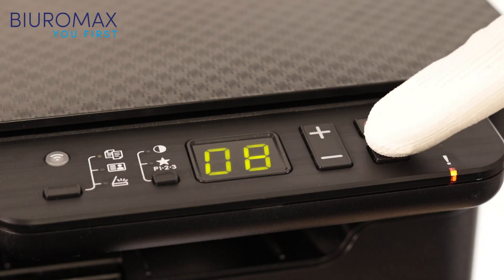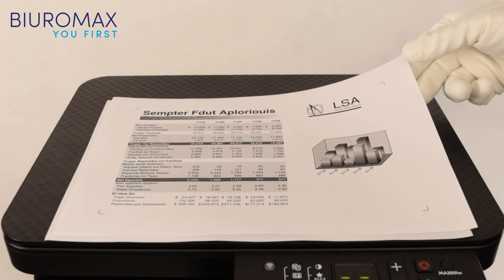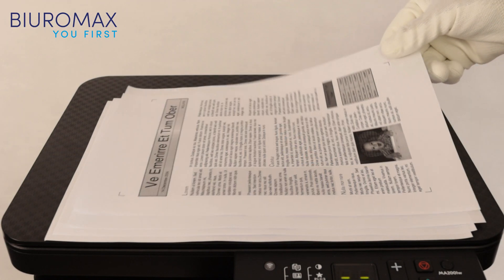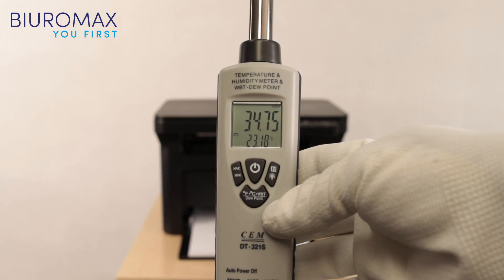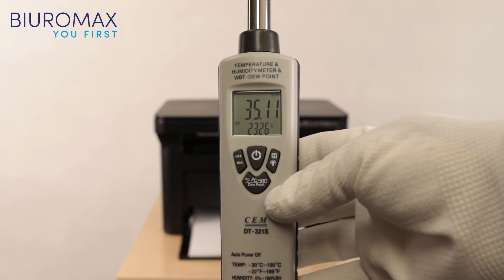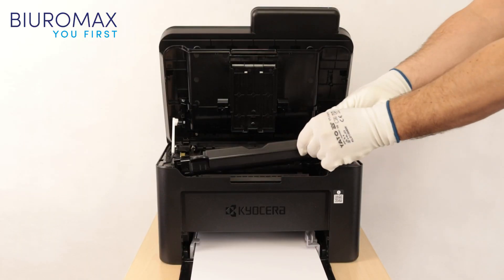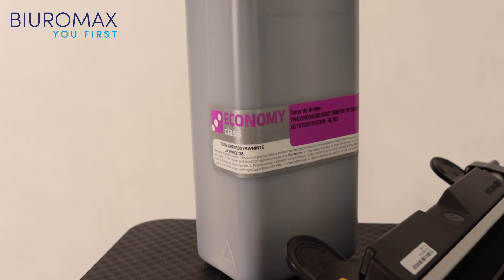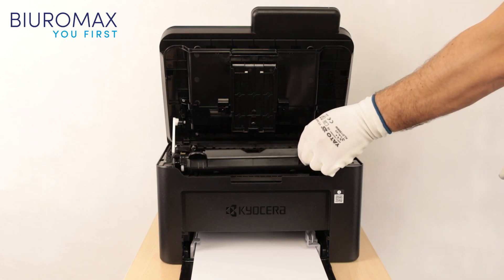The first copies and prints made with the original toner will be used for comparison after the test. Test sheets with five percent toner coverage were used in the test room. The temperature ranges from 22 to 23 degrees Celsius and the humidity is between 32 and 35 percent. The original toner is removed from the copier and a cartridge regenerated with the test powder is installed in its place. The yield of this cartridge is 1500 pages.